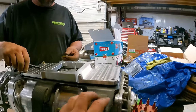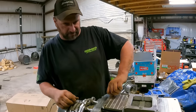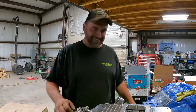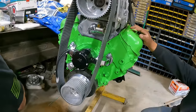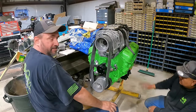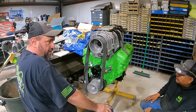People are probably wondering what's this thing about — what's the black with the straps? So that is for when it explodes and you don't scatter parts all over the track. We're going to run this straight with a flex hose into the top there, one flex hose into the bottom of the radiator. No thermostat. Just straight flowing water. Probably just water, no antifreeze.